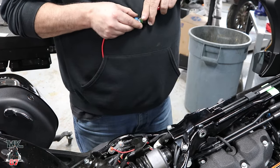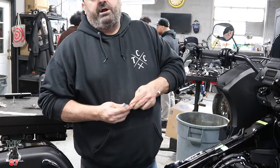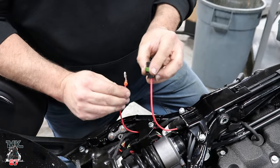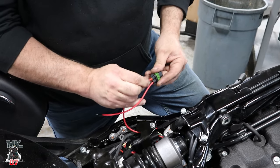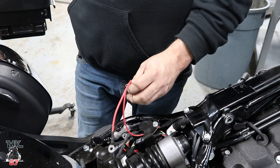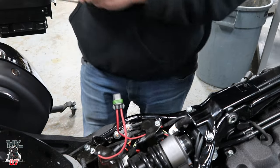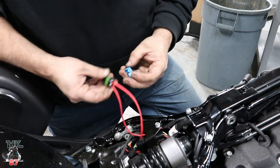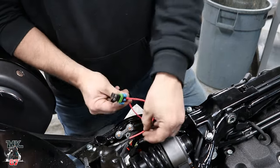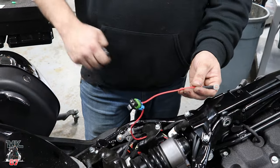The old style you'd have to cut, solder, splice, and put it together. But now they've got a different style fuse holder and the lead for the fuse is already connected. All you have to do is remove the blue plastic, slide the pin in, pop it back on, and now you've got a fully connected wire to go down to your battery. It's easier and cleaner now. The other ones I've done in the past, I had to break out the soldering iron and solder it. So you remove the blue plastic, take the new terminal, slide it up in here — click. It's got protection from the elements. Slide this back over and that's it. Ready to hook up to the battery. We'll put our fuse in and put the top back on. This is all waterproof.